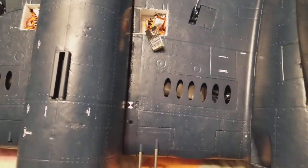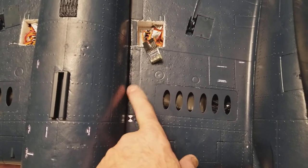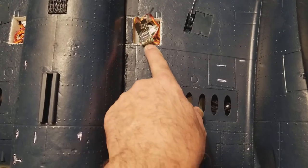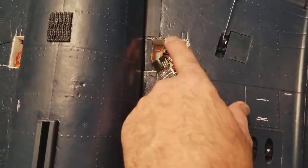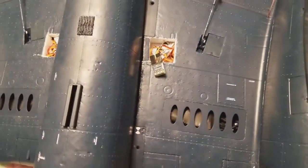In addition, which is a nice plus, the throttle channel used to have to go through here with the battery leads. I've made a custom hole that went across right here with a brass tube, and now the throttle is connected here, so the only thing here is the battery connections.